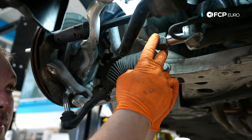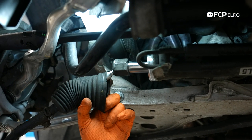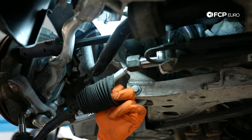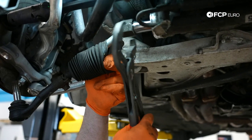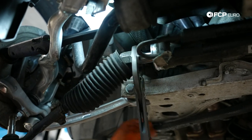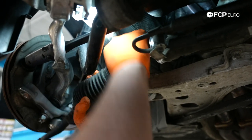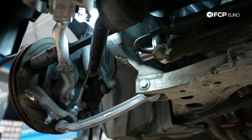That gives us access to the nut on the pinion for the steering rack. I believe this is a 38-millimeter. When you remove it, I don't worry too much — I just use really big channel locks. It's not reverse thread or anything, just righty tighty, lefty loosey. I've had really good luck with these pliers on steering racks before, and from here you can spin it off by hand.